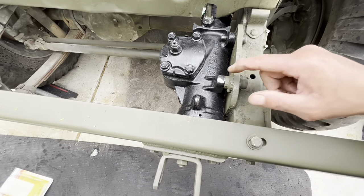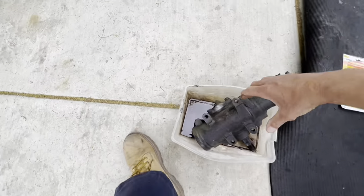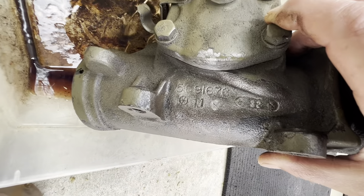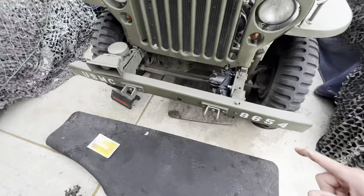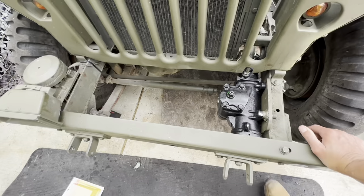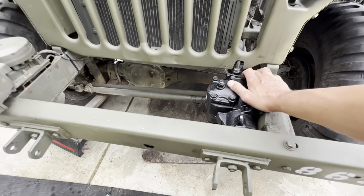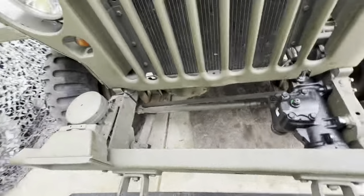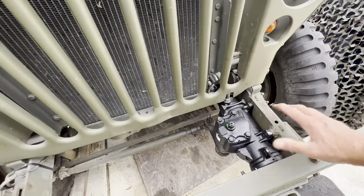One week later — alright guys, just switched out my steering box. Part number 569-1676 is the old one. It's a GM part, BOP, used I think from '64 to '76 in GM models. This is 13/16th and that one's in 5/8. It hooks up to the link here, bolts onto the frame — bolted right back in. I was very happy with it.